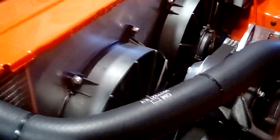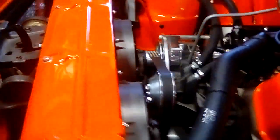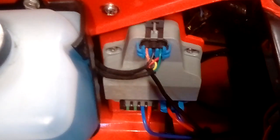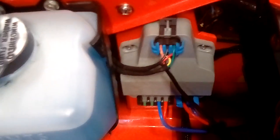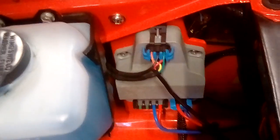It's not cheap — it's expensive — but if you don't get it, you could get a chance of overheating. What I like about this setup is that it comes in all one unit, all aluminum, really nice, and it comes with its own control module where you can preset your settings for when you want the fans to come on. It's very easy to set up — there are pins on the backside where you set the temperature you want it to kick on. I put mine at 182.